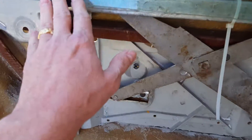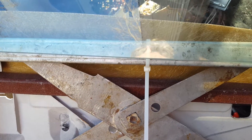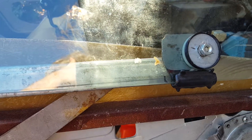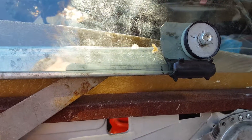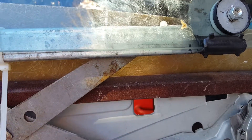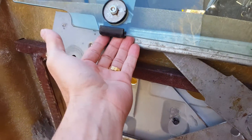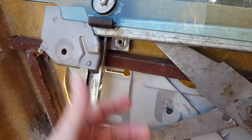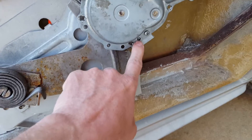As it's turning out, I'm not getting these two to line up level. These two here are not coming in level — you can see that one's higher on the bar and this one's lower on the bar. So I haven't attached them in any kind of way just yet; there's a gap in here. But that's my next thing — I'm going to have to attach those to that bar and then run the motor. I did re-clock the motor, so I drilled some new holes in the bracket. You can see it gauges properly and stays out of the way of the main bar.